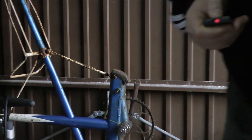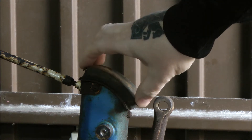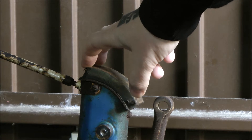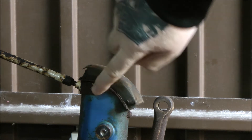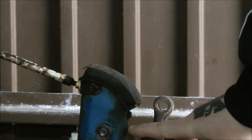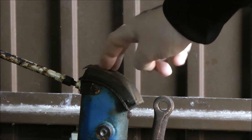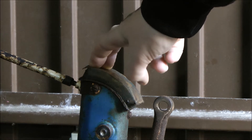I'll zoom in and show you. The rubber block — basically there's a piece of metal that attaches to it that is then riveted to the rear fork. This had already split before I started to remove the swinging on the rear fork. If it hadn't, I should have removed these screws — one at either side and one underneath. If you don't remove those screws and your rubber block is still laminated and together, as soon as you start trying to remove the rear fork you will twist it off. If you twist off the metal it's not so bad — you can clean up all the rust and glue them back together with a decent flexible bonding agent.